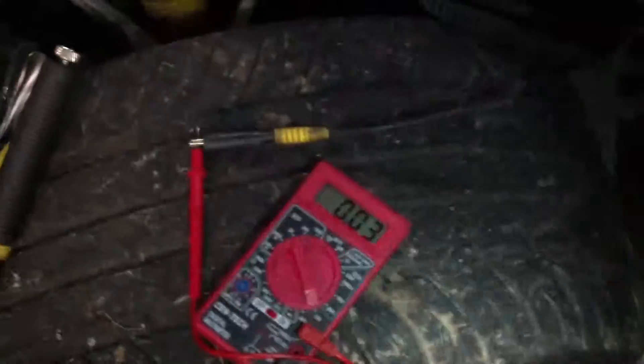Red lead — got it hooked up to a jumper here. This looks kind of rigged because it is. Side terminal batteries suck — thank you, GM. Top posts are a lot easier to deal with. I use a little alligator clip, peel back the vinyl, and get a good hold of the side of it. You need a good solid connection; things need to be clean. Down here I just stick a bolt in the battery and then take a pair of vice grips to hold my test lead so it stays put.